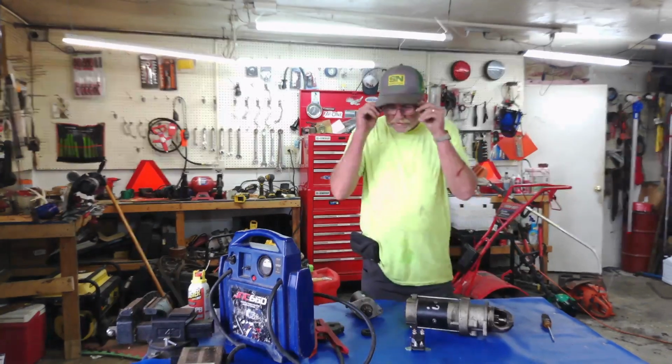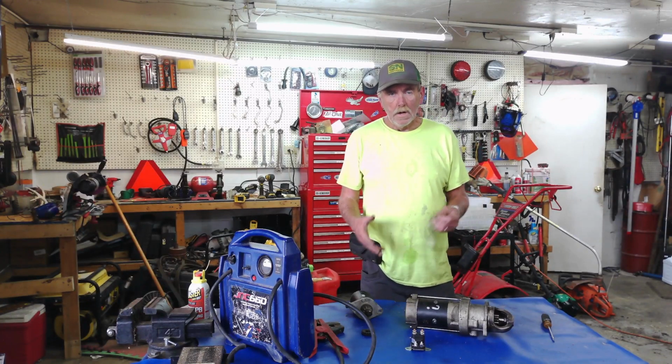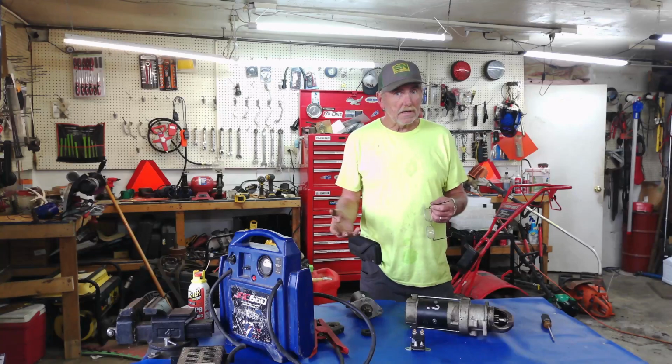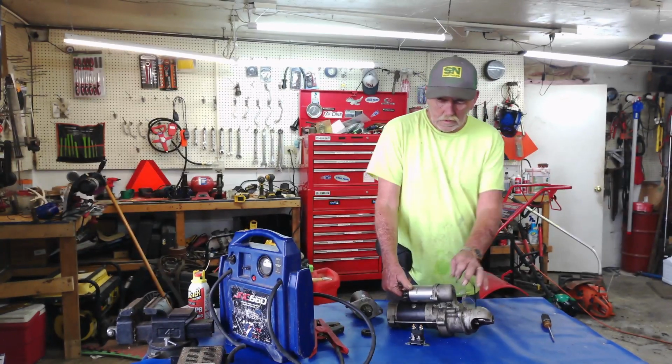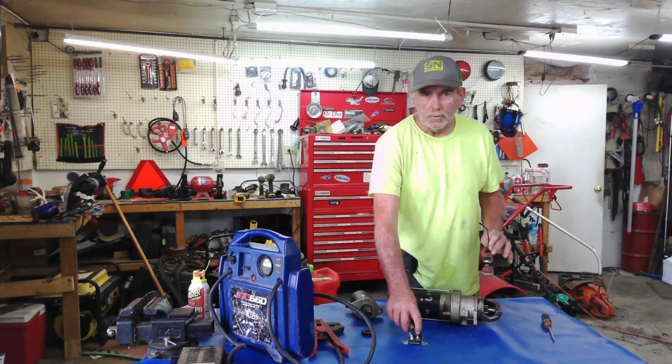So hopefully on that note you've learned something today more about your system and why it's making that clicking noise. Most times that clicking noise is here or in here. And it's usually dirty posts or loose posts.